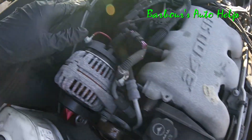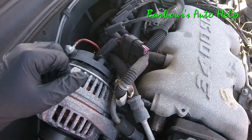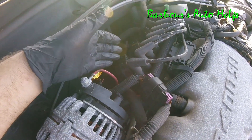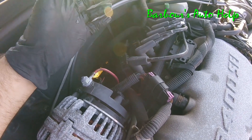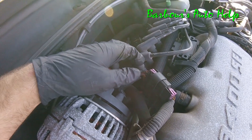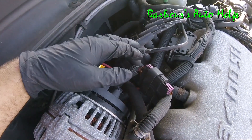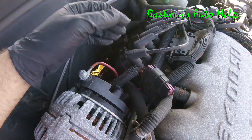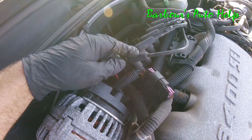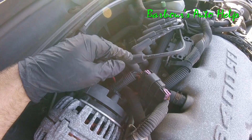It's 2, 4, 6, 1, 3, 5. It's real easy to correct your firing order on this particular vehicle because of the numbers on the coils. But it's a very common mistake after doing a tune-up — a lot of people cross the wires still. If you did cross your wires and your engine's running like snot after you've done a tune-up, just check your firing order. That's the number one cause of the engine not running correctly after doing a set of wires. Just make sure your wires are routed to the correct place.